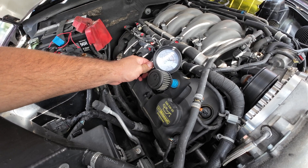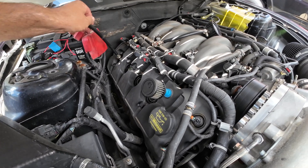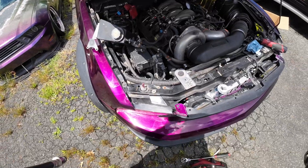I'm pretty confused because those are really good numbers. Unless it's only leaking when it's hot, but usually leaks happen when it's cold — when it warms up the rings expand a bit. I could do a leak-down test but I don't have a compressor here. You've got to be able to throw pressure into the cylinders, and you also have to be at top dead center so the valves are closed. I can't really find top dead center because there's a supercharger in the way.